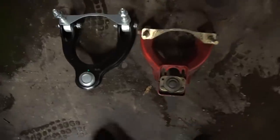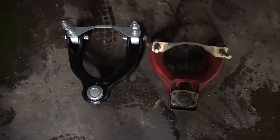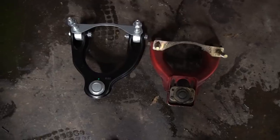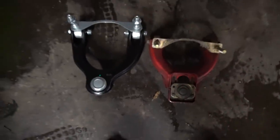Last season I was setting up this car with my Work Meisters, getting it slammed and cambered. To fit the wheels properly we had to shorten the front upper control arms — which sucked, don't do it. Looking at the difference, the new one is much longer, which will take a lot of camber out and hopefully bring the car back to a decent alignment. It won't be perfect and still needs to get dialed in, but it'll be much better. I'm stoked — going to slap this one in, put it all back together, and do the passenger side.